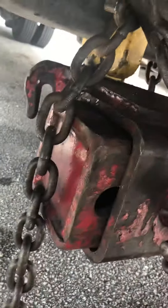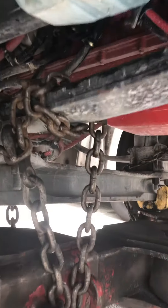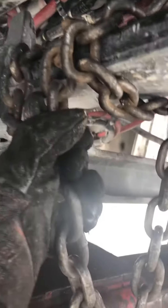What I do is I take the hook end and throw it over the spring behind the axle. Then it's gonna be under my t-bar right here. I bring it up and tie it to itself. Then I take the slack of the chain — it's gonna be pretty tight — and do it twice over the spring like that. Then it shouldn't move anywhere.